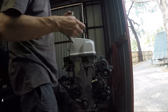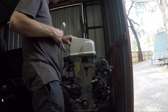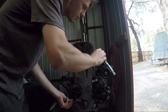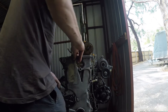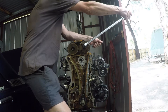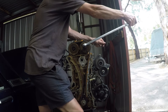We'll put all the bolts in bags so I know where things are and label them. I've had the timing cover off before, so I just left two bolts holding it on. This one is very tight — 80 foot-pounds or something, I think. And the goal is to stop it moving.